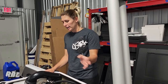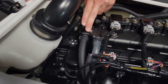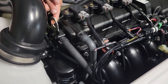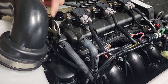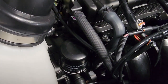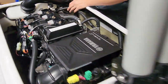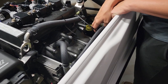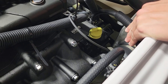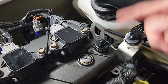It looks absolutely pristine, so we're going to go cold and extract it from both the crankcase and the reservoir. Go ahead and remove your hood and locate where you're going to be working. The oil extraction point for the crankcase is going to be this rearward hose here — it's textured and mounted to the rear engine hoist point. That's your crankcase access, your oil filter is easy access right there, and your other oil extraction point is going to be from the reservoir. This is actually your dipstick and the knob to unscrew it, so you'll be extracting oil from there.